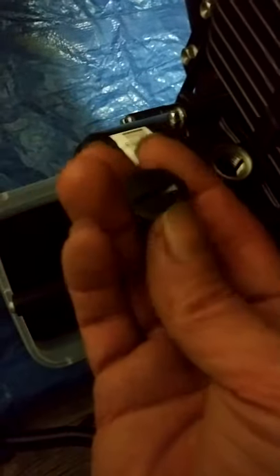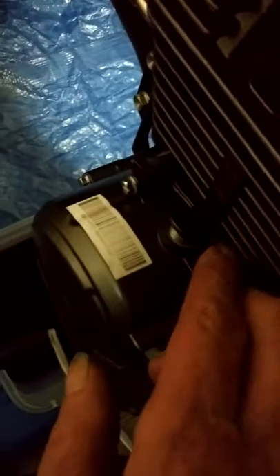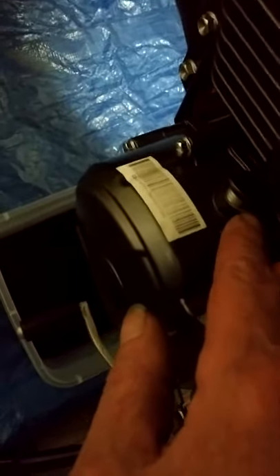You can even use one of these — an 8mm little T-wrench. Good hard snug, if you don't have a torque wrench, that's how you do it. Also, make sure you pop this baby off — just let it breathe, give it some vent. This is on the opposite side. That's what the cap looks like. You can use a quarter for mechanics — it fits perfect, better than a wrong-size flat-head screwdriver that'll scratch it up or nick it. Leave it open, let it breathe like that.